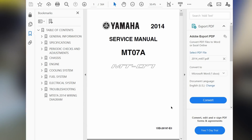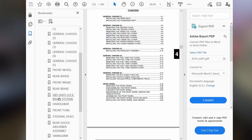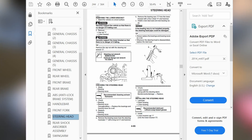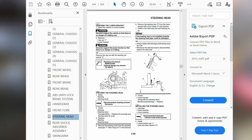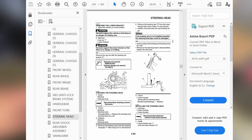I was about to do this video having a laugh, but to be thorough I looked for other sources. I went to a 2014 MT07 manual, and lo and behold — it says: 'Remove the bearing races from the steering head pipe with a long rod and hammer.' And then: 'Remove the bearing race from the lower bracket with a floor chisel and hammer.'